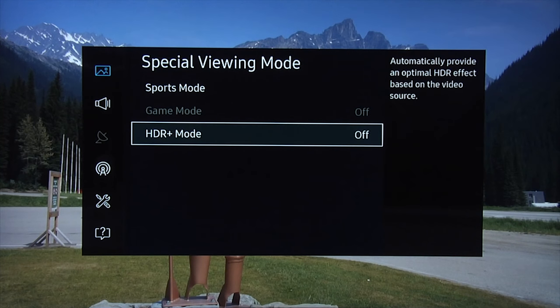HDR Plus mode is basically a fake HDR mode — it increases color saturation and dynamic range, but it's using SDR content which was never graded to be seen in HDR. Whilst on occasion it can look quite good, it can also look quite terrible depending on the content. Ultimately, you should be watching content as it was meant to be seen. SDR standard dynamic range content is graded to be seen using D65 and Rec. 709, so that's the way you should watch it. HDR content, of course, should be seen as HDR content is meant to be seen — we'll show our HDR settings a bit later on.